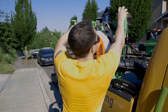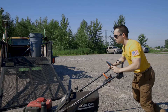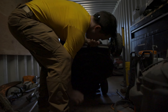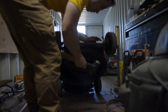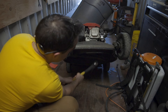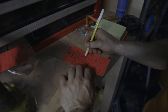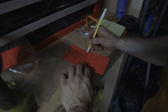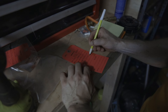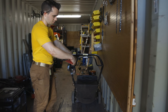So on this property, after blowing off, this is when I'd go talk to the customer, make sure that they're happy, make sure everything is to their satisfaction to reduce callbacks. But now I've got to fix this mower. This is a 20-inch Honda mower — I hit the PVC pipe. It actually never hit the blades — it hit the front guard, the metal rim. So I'm taking this hammer and beating it back forwards so that the blade isn't hitting the rim every single time it turns. I basically got it worked out. I am going to have the maintenance guys take a look at why the blade stopped so much — it shouldn't have been stopping like every 30 seconds to a minute.